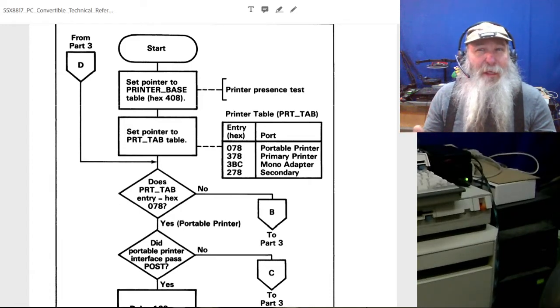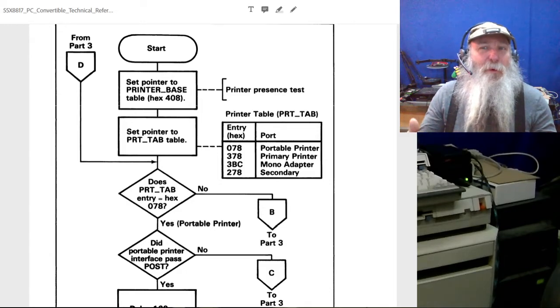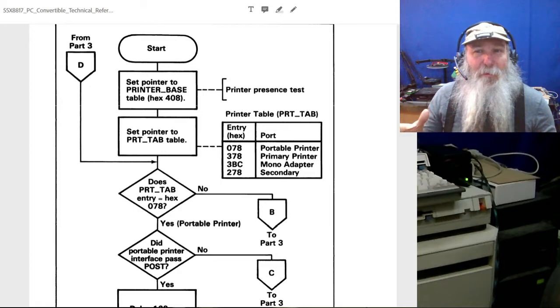the thing would be, what happens when you put another slice on there of the parallel and serial port? And I'm sure that these slices, it's not where you can put another CRT slice to get another CGA output, or I wouldn't think so. Because that interface chip for the CGA screen does respond back to the system, and there's more interaction between the CPU and that particular slice. So you put two on there, I just don't know how it would deal with the conflicts. And maybe it would be more worthwhile to check out, but I wouldn't think it would work, as much as with this, what I'm inclined to believe.